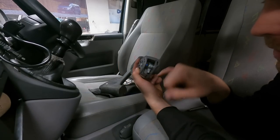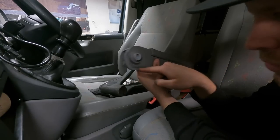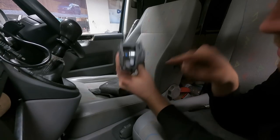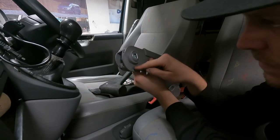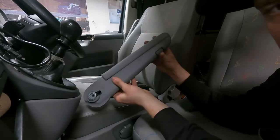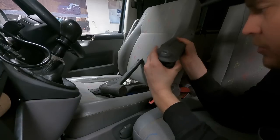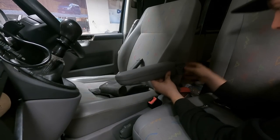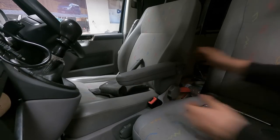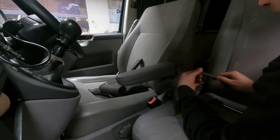The pin that broke off the old one - that's hanging down there, which you can see inside. When you put it in, make sure the screw inside - the adjustment which changes the angle - is as far in as it will go so that pin can pass the head. I then pulled that pin round up to the top so I could get the screwdriver in again to back it off, so this now spins and goes in the right way. That's all done. Adjustment on the armrest works.